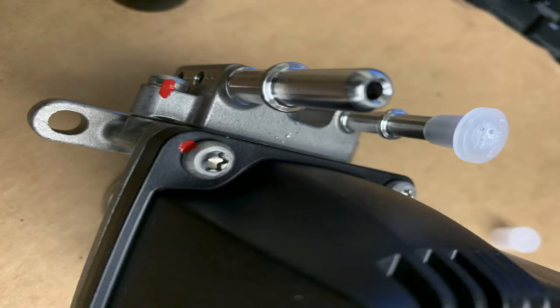Here is that stainless block. It bolts to the side of the main body with your two stainless tubes that your DEF lines go on. And they are marked — there's a supply and a return. The reason for that is the supply has the filter built into the main body. The filter would be built into the aluminum, under that black cap.